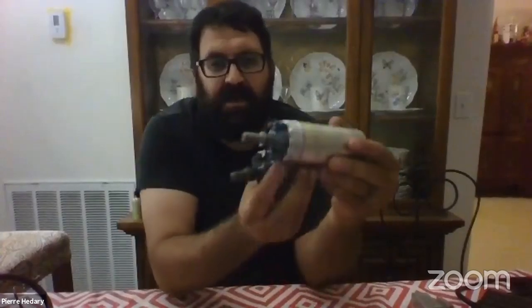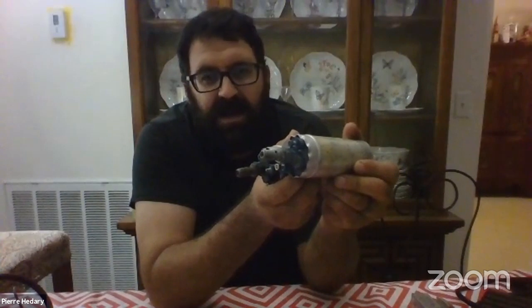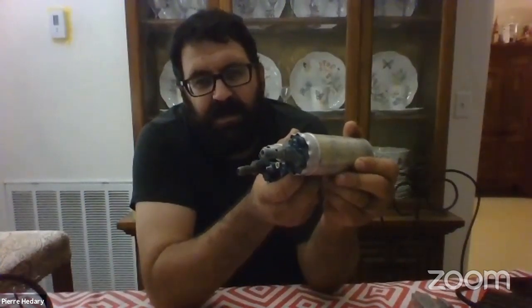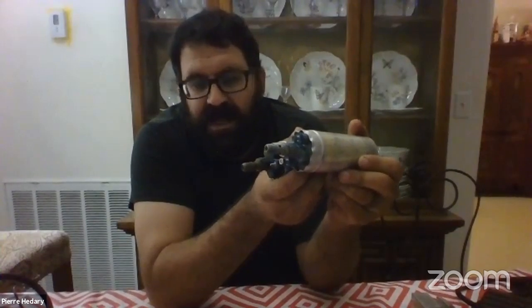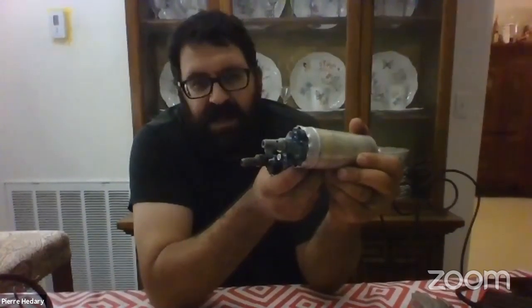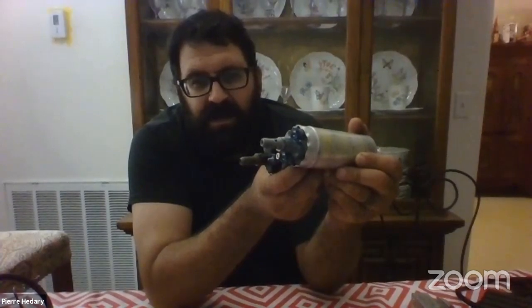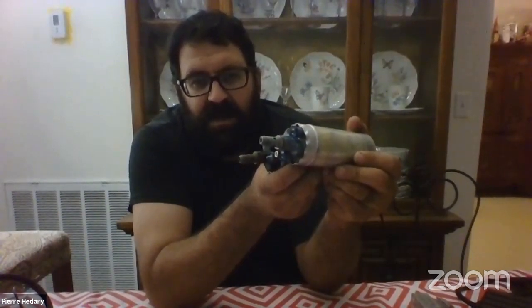In the last presentation I talked about the fuel pump relay — a little square black relay that turns on the fuel pumps. These fuel pumps are located at the back of the car in a bracket. Instead of one fuel pump, some but not all KE cars used two pumps. Cars that used a single pump include the 190E 2.3, early versions of the 300E in 1986, the 300SE and SEL 126, and early versions of the 190E 16-valve.